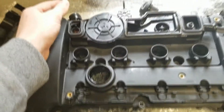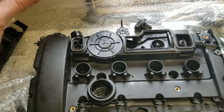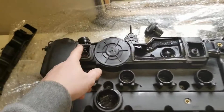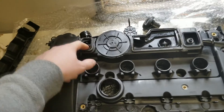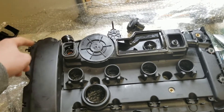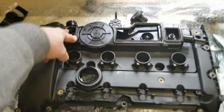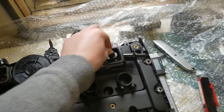Then it's got to go through the throttle body as well. So if you're at low RPMs and the throttle body is nearly 95% closed, you're not actually going to get great suction on this side, which I think is why they also use the direct route — because this one goes directly to the intake manifold after the throttle body, which means you've always got maximum airflow. Then obviously when the engine spools up and the turbo kicks in, it goes through this other side.